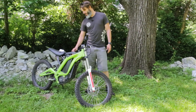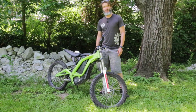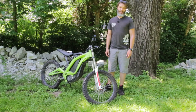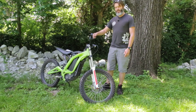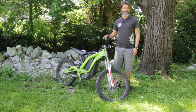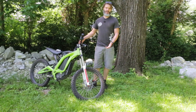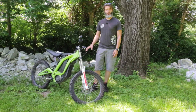I was skeptical about the little percentage indicator on the battery being any real indicator of state of charge, but I've found it's close enough to use. The other day I forgot to charge my bike and had to ride about five miles one way and five miles back — about a third of the total range on the bike. I pressed the little indicator and it told me I had 60% left. I assumed I'd have around 35-40% when I got back, and when I returned to my shop it was exactly at 40%. It's been a lot more accurate than I thought, so now I don't need a secondary cycle analyst to track amp hours — less clutter on the bike.